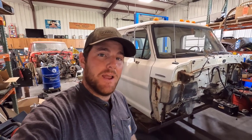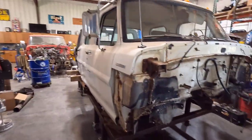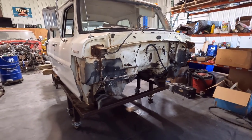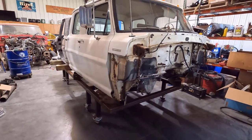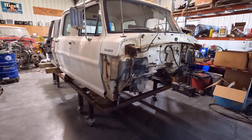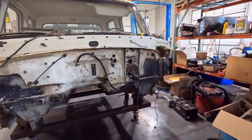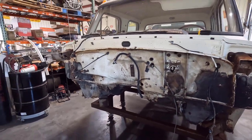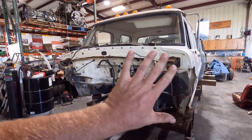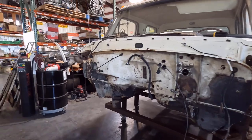I think I made a decision on what firewall plan to make. In that video I was test fitting the firewall and everything with that engine to see if I could do it with the factory firewall. After I got done editing that video I messed around with it some more, and I actually got it to fit — the tire was centered in the wheel well with the engine in there and an unmodified firewall. So I know it will work with the 6.7 Power Stroke.